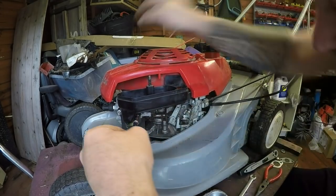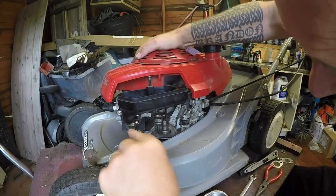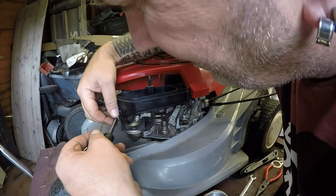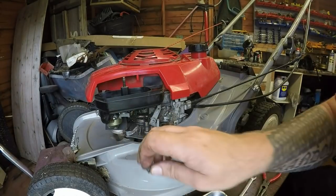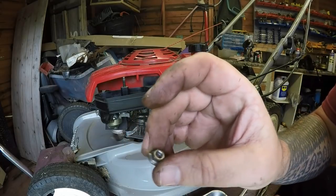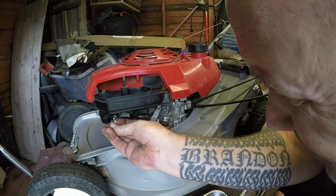That one doesn't want to go. I'm going to take the studs out and try and clean them up if they don't go much more, or try and find a slightly smaller nut to wind on there. I think what it is, the collar on this nut is striking just that edge there. So I'm going to try and grind this nut off. I don't have an 8mm nut somewhere. Well, I've probably got loads, but I just can't find one. So I'm going to try and grind that off so that it's nice and smooth, and then try and run it down.